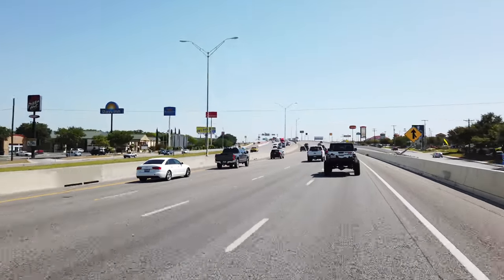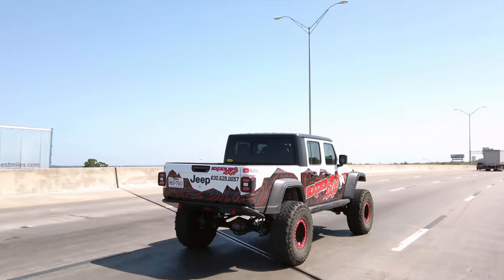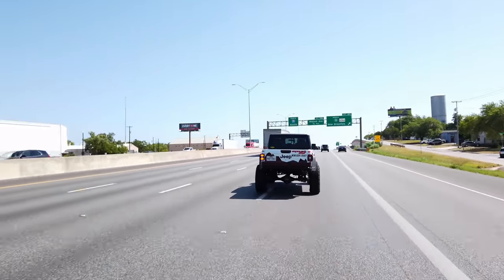Getting out on the highway, we're doing about 65 right now in heavy traffic. I'm watching the temp and it's at 201°F. It's 99 degrees ambient temperature and the humidity is pretty high out here too, so maintaining 201 is pretty good. That's always been a big concern with Hemis — keeping them cool — and that doesn't seem like it's going to be an issue at all. I haven't had a single warning light or check engine light come on, and that is huge. Started on a Monday morning, took our sweet time, wrapped it up Thursday evening.